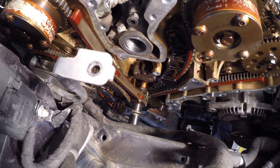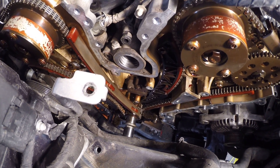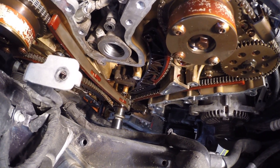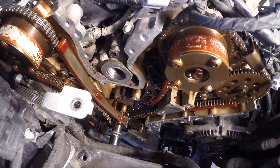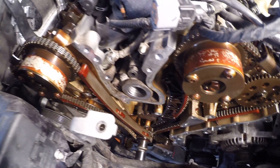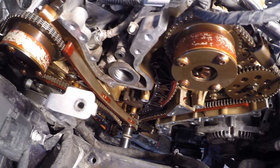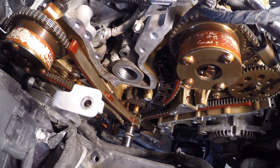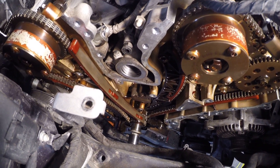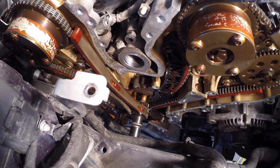The one down below is sitting pretty solid, pretty firm. But this one here — did you see that? That should not happen. When the engine's running and you've got oil pressure behind it, you're not going to get that happening unless the tensioner gets really bad, which sometimes they do. The chains can actually get sloppy enough that you can get some rattling on the timing chain cover that can cause problems. This one is definitely bad. That tensioner should not move that way.